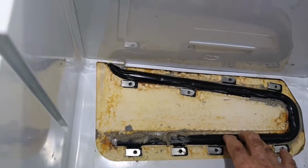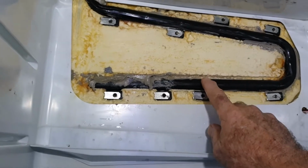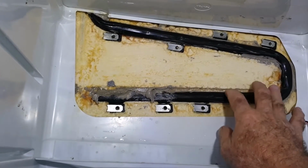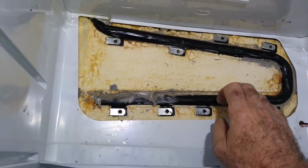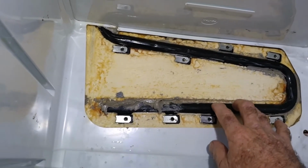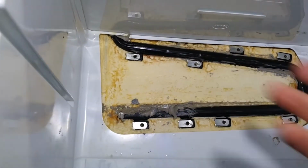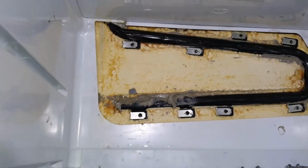But it just seemed this was done by Dometic as a result of complaints about this fridge. They did a couple of fridges at Jayco, and one of the things they did was pull this mastic out and reapply it, apparently, and that improved it. A couple of people reported that made a huge difference to the performance of the fridge. Anyway, I'll get on with it. I've got to clean all this down, get all the mastic off, and then give it a clean with isopropyl alcohol or methylated spirits or some sort of solvent, and then I'll start on the reapplication of new stuff.